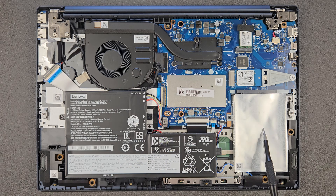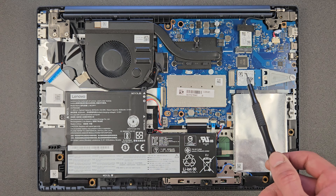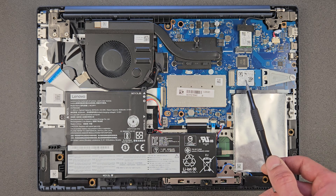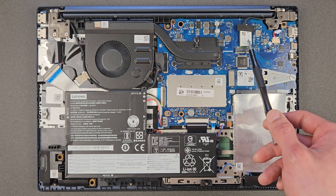Interestingly, there's a 2.5-inch hard drive bay there, unused and empty at the moment. You can put a solid state drive there, or whatever you have — maybe a normal hard drive, though I don't recommend that for the operating system as it's a bit slower. Right now there's a 256 gigabyte SSD in it, and we're gonna replace that with a one terabyte drive in just a few minutes. And that's your WiFi card of course.